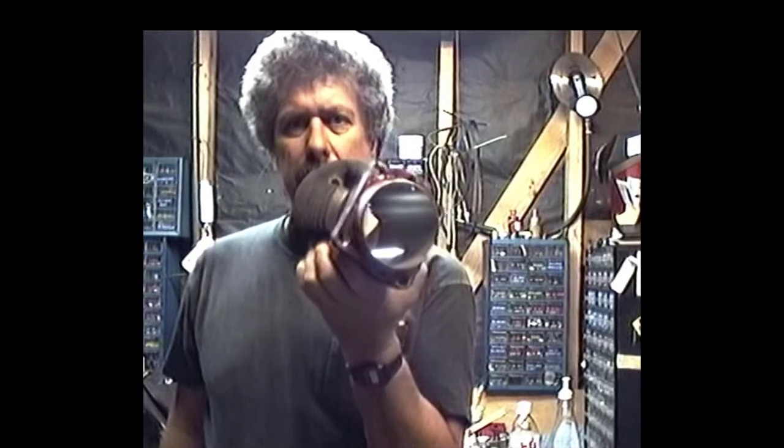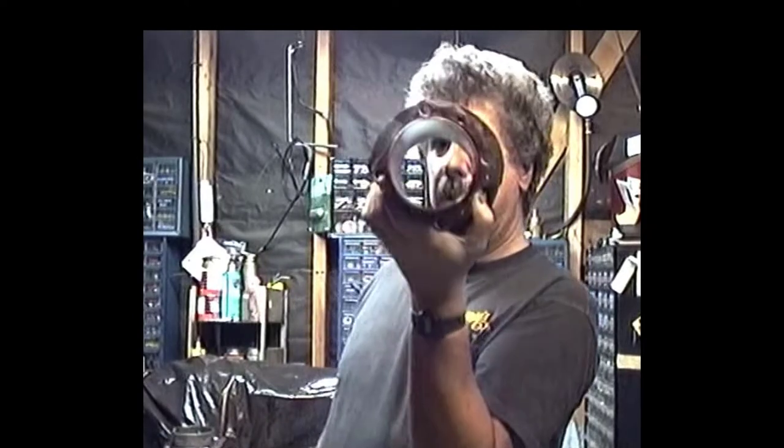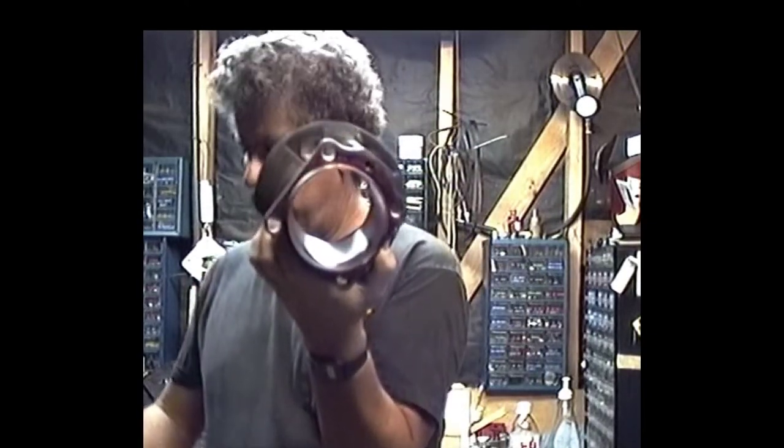Okay, as you can see, this is the cylinder that I just finished boring, and you look down that barrel, and the finish is pretty acceptable looking, but that's sort of a false thing there. Now we're getting a closer view of that cylinder which I just bored. You can see a little bit of evidence under closer inspection of some horizontal lines in there. Now, if you put your finger in there and run your finger across that, it's as smooth as glass. And you wouldn't even think that thing was anywhere near what you'd call a rough finish.